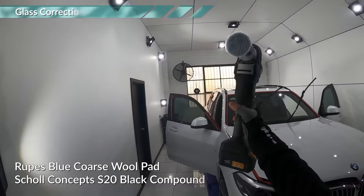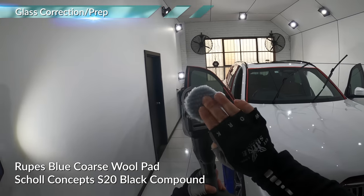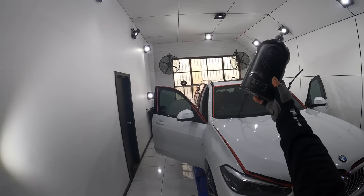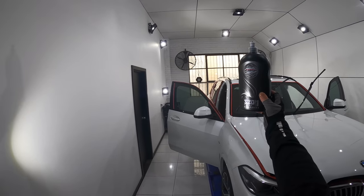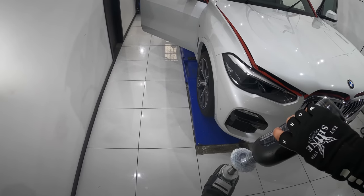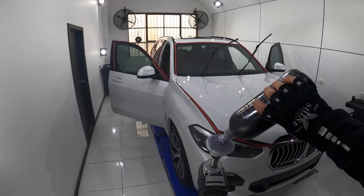Now, as I mentioned before, there were a few water spots or etchings on the windscreen and side glass that using a foam pad and fine polish just weren't removing. So I had to find a slightly more aggressive combination to remove them. This turned out to be Scholl Concepts S20 Black on the Rupes Blue Coarse wool pads that dealt with those